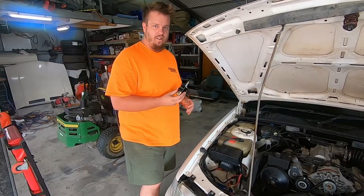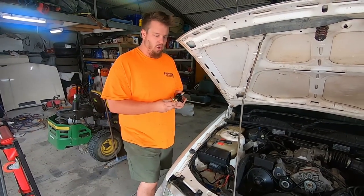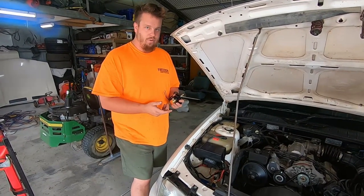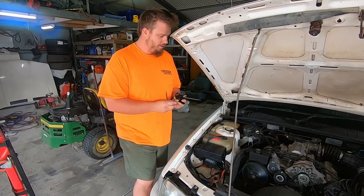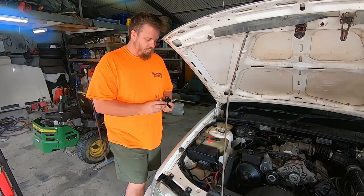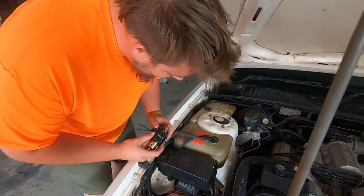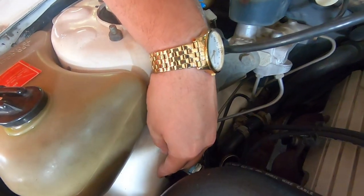Right, so line lock. Normally they're used to lock the front brakes on to stage in drag racing in a manual car mainly. We're going to use it backwards so we can lock the back brakes off and still use the front brakes, being that it's an auto and it gives you a bit of control through your burnout, which you only ever do on the drag strip or in Mexico. So the plan is to fit it down here somewhere, if you can see.